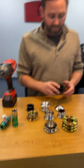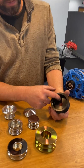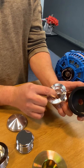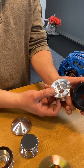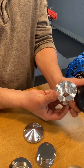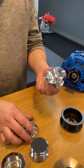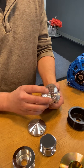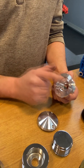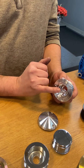When you're exchanging pulleys, it's important to note the depth. Notice how shallow the back wall of this pulley is compared to this other pulley — this pulley here is not going to have hardly any threaded shaft protruding through the hole whatsoever. In this particular circumstance, if you absolutely have to use this pulley, it's going to have to be machined down until the appropriate amount of threaded shaft protrudes through for full thread engagement on the nut.